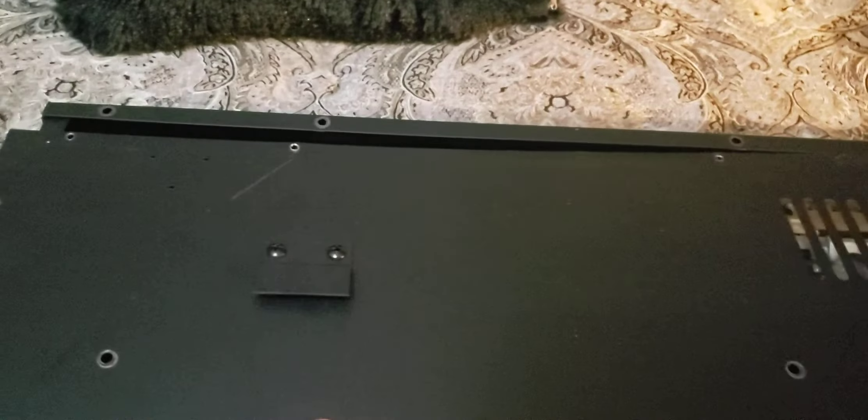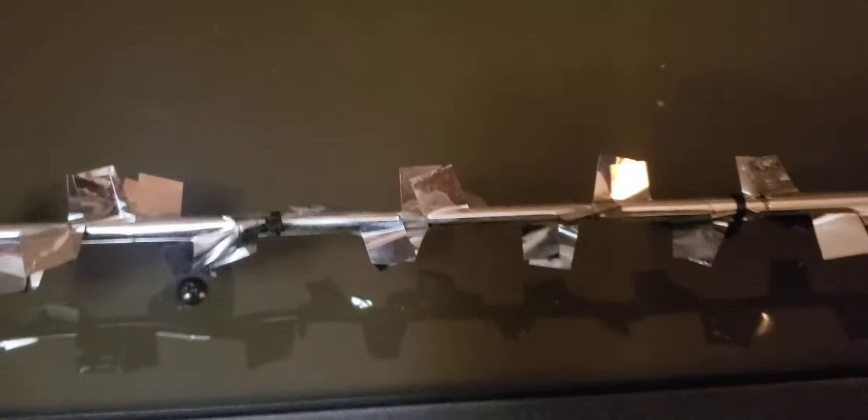I got the back removed. I was wrong — you don't have to remove the bracket that holds it up for the mount. So you flip this up and here's basically how it works: you've got your LED lights in there that light up, reflects up here, and then this thing slowly turns, and that's what gives it the illusion of a moving fire. That motor right there is bad and needs to be replaced.